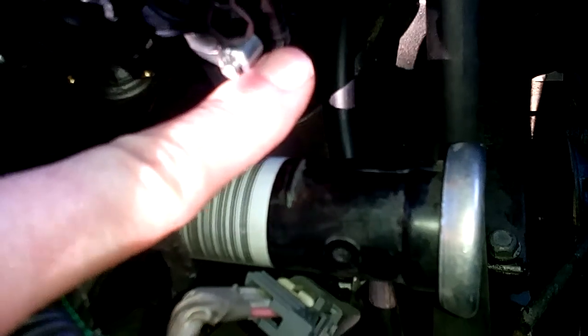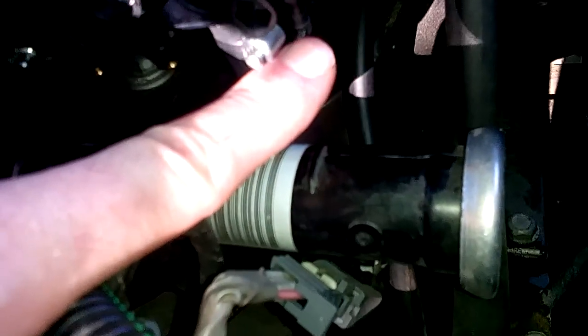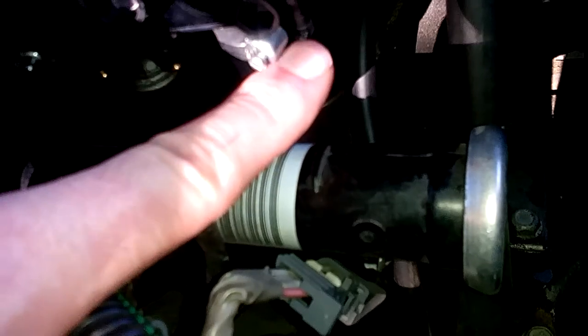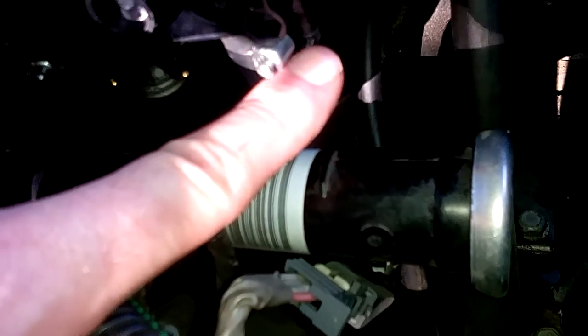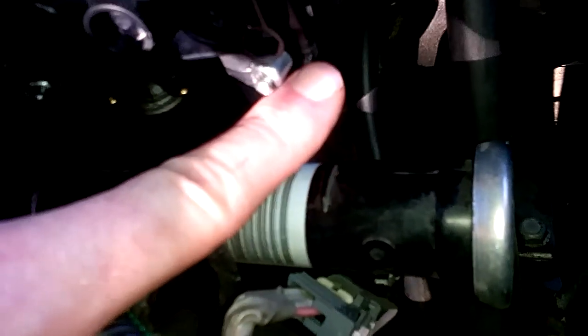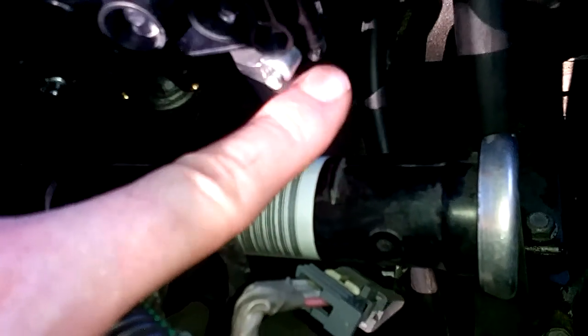What's really cool about these OMVL injector rails is they've got a temperature sensor and a pressure sensor output right there. I didn't use any glues, because the oil from the natural gas dissolves the glue and the caps will eventually leak. So I bought a plastic welder and filled that in with plastic and welded it in there. If I ever needed to change it I could just drill that back out, but this way they won't leak.